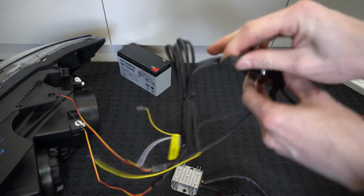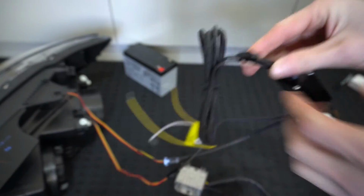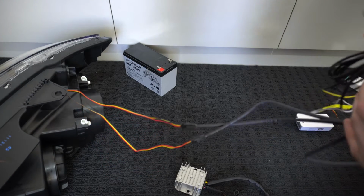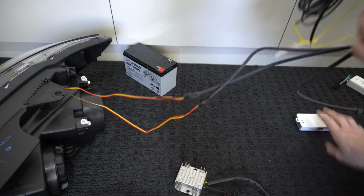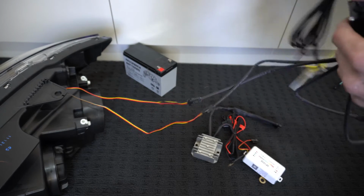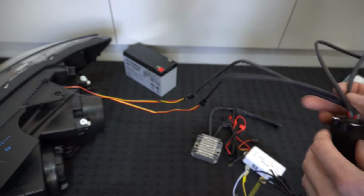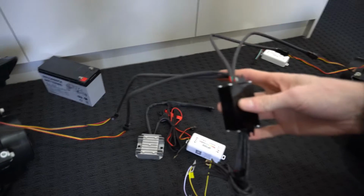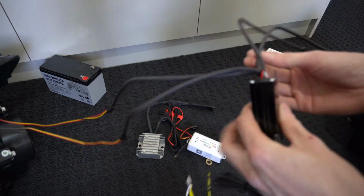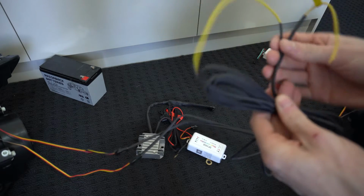So again, we've got the other end of our big plug here. We've got our Bluetooth module end, which was in our power supply down here, so that connects into here. Our driver connects to our power supply. We've got 4 outputs here for each ring, so I've got 2 for our right, 2 for our left, and we've also got this lot of cables here too.